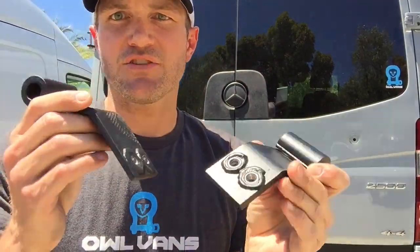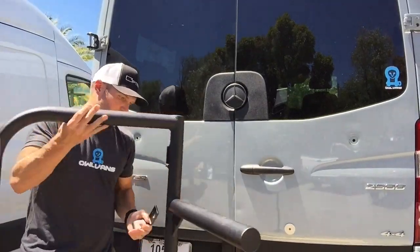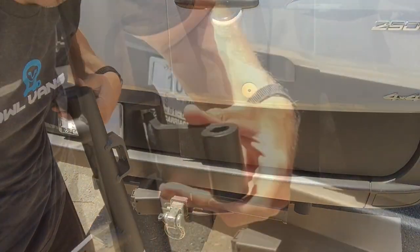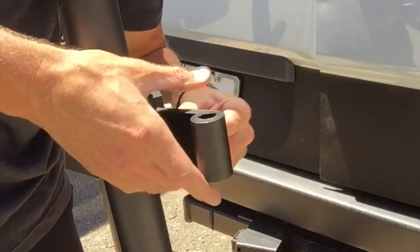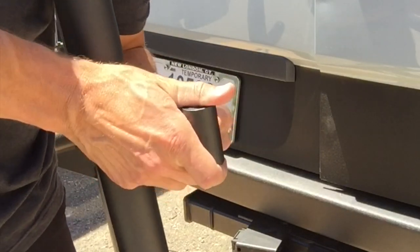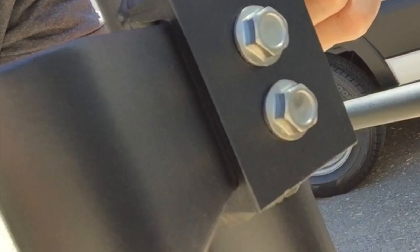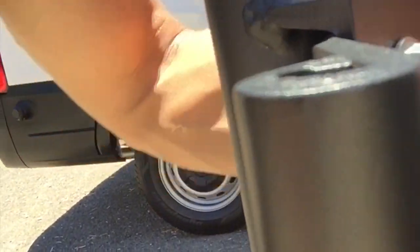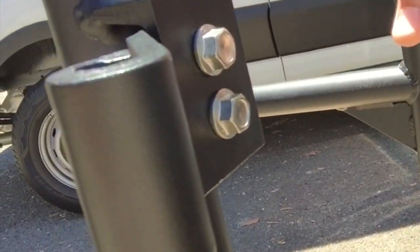Now we're going to move on to the part of the hinge that connects to the actual bike rack. You should get two of these — one long, one short. Short one on top, long one on the bottom. These are stainless one-inch bolts. This hinge goes inside the bracket and then this bolt comes in from the back side and screws in. You want to put these on before you mount your rack. You can tighten these way down — we purposely designed it so that you have aluminum sandwiched by steel into steel, making it very, very strong. The way we welded a piece of channel in an arc horizontally means this is an incredibly strong structure. You can tighten these down — 70 to 80 foot-pounds is fine.